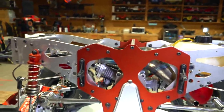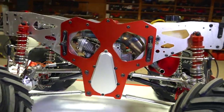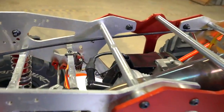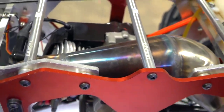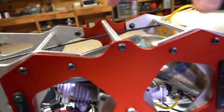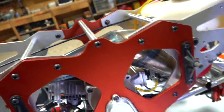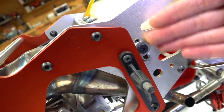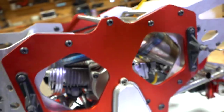Look at this right here — ta-da! I love how it looks like a Punisher skull on the side. Now, the whole thing is why haven't I run the engine if I've installed it? You'll see my pipe is kind of burnt right there. To get this engine in, you have to remove these top braces, remove some pieces on the bottom, and then you have to drill a new hole for the stock exhaust pipe to sit on there.